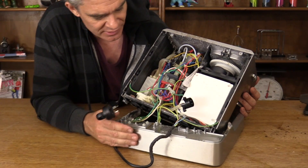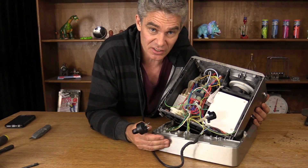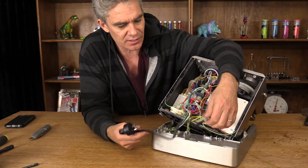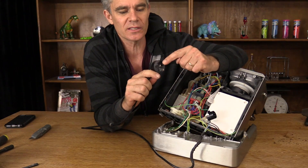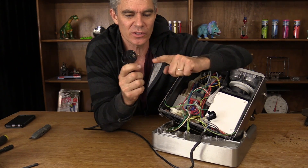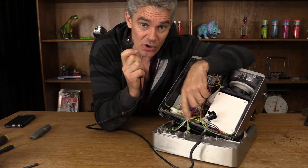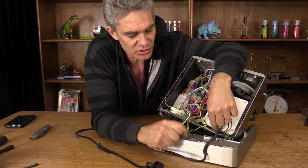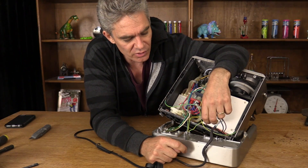Let's see if I can work out what's going on in this beast. I don't want to fix it, I just want to see how it works. Firstly, in comes the power. The top one is basically positive and the other one's negative. It's alternating current, so it goes backwards and forwards. But the bottom one is what's called the earth lead, and the earth lead is this green wire, which is attached to the metal base, which we'll call the earth.